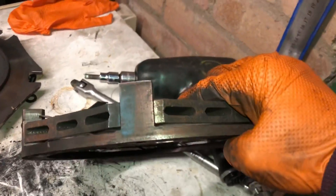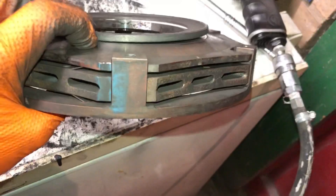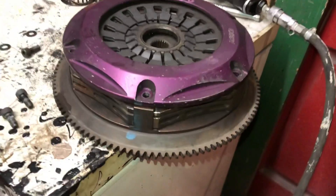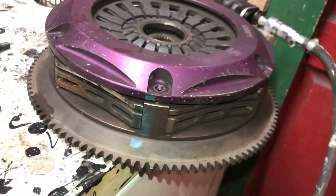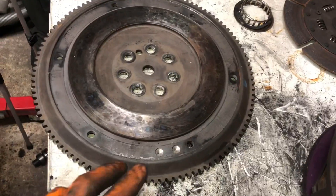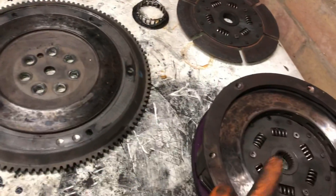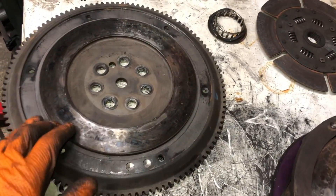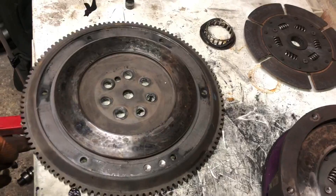I've had to turn it upside down to get the markings to line up — and now all the plates are lined up in their proper position as they should have been from the Exedy factory. That's to limit the amount of vibrations. You can see the marks line up all the way from the flywheel up through the plates to the cover plate — that's how it should have been. The holes drilled into the flywheel are from a balancing machine where it was balanced with the clutch, which is why it's so important to have it all together properly.